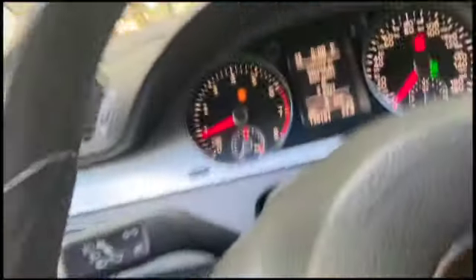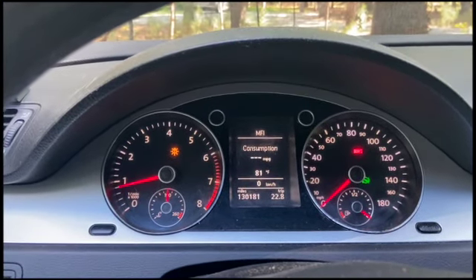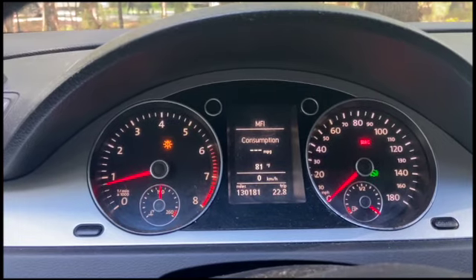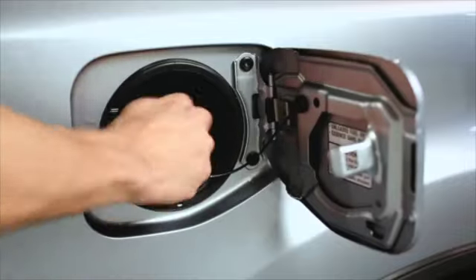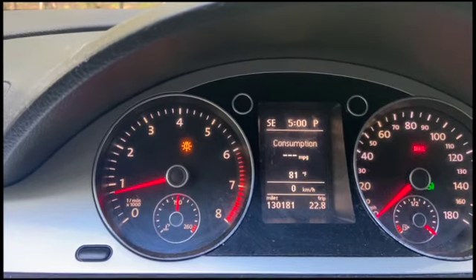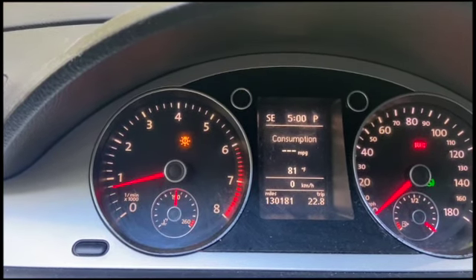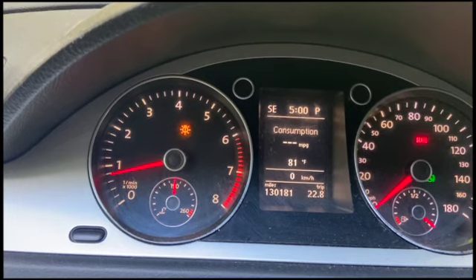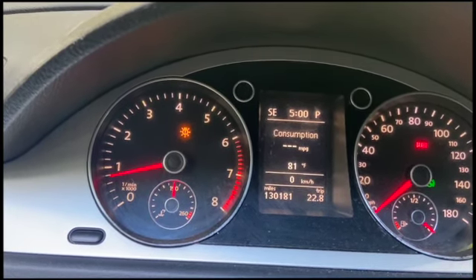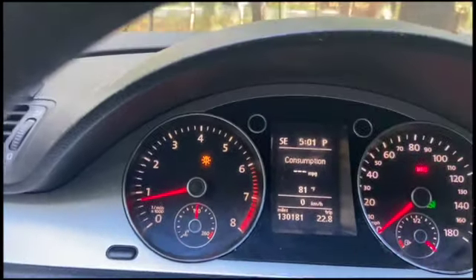If you do not have an OBD reader, this can be maddening — in my case I had no check engine lights at all. For most cars, a flashing check engine light indicates misfires; a steady one is less serious, but a flashing one can indicate much more serious problems including misfires. I decided to try to force a code by pressing the accelerator further and further when it started misfiring instead of letting go. Sure enough, it gave me the misfire flashing engine light code. But while I now knew I had misfires, I was still not sure why.